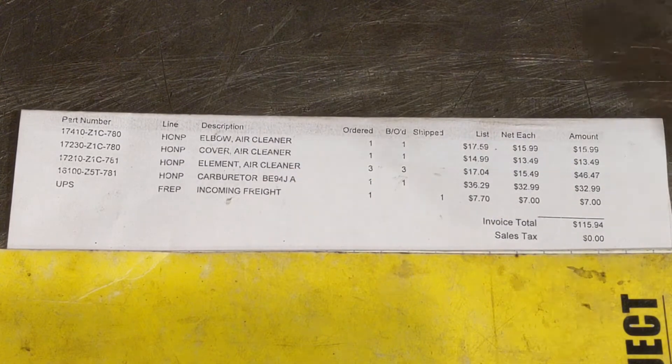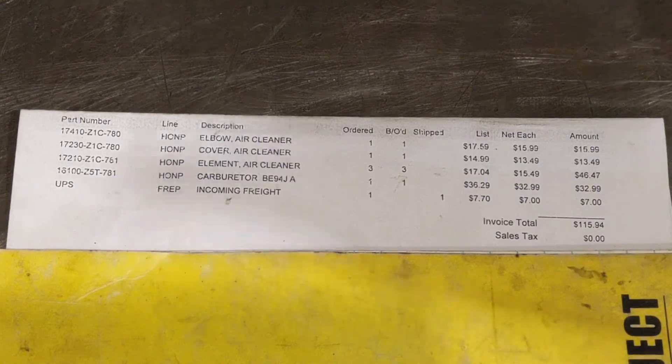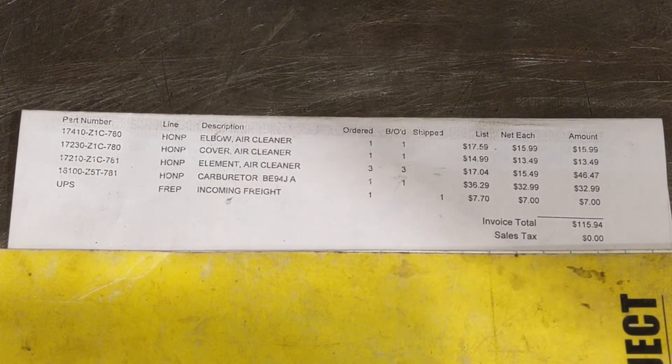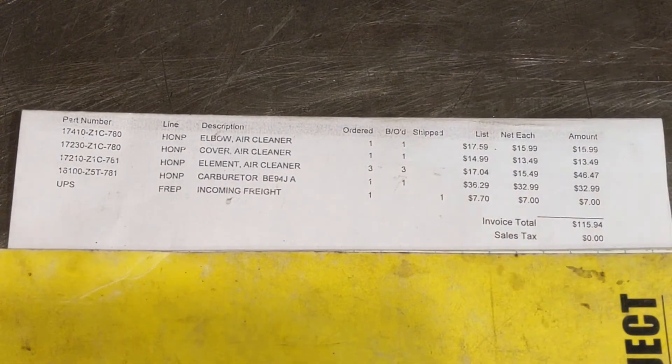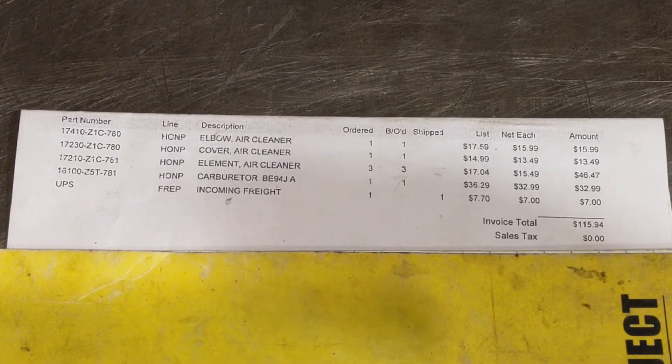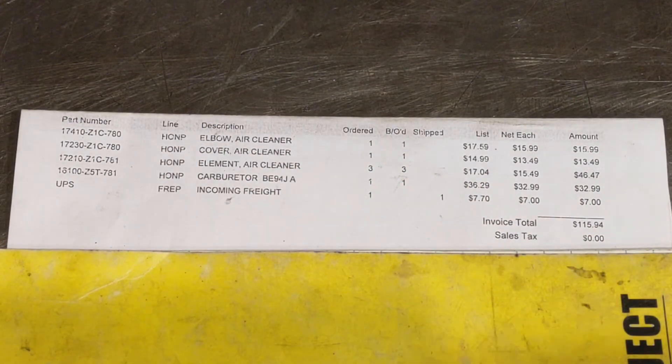The carburetor does change — the original carburetors are non-compensating, they will not adjust for intake restriction. When you put the pre-cleaner on there it induces a little bit of intake restriction, so you have to put that compensating carburetor on there. If you try and run the cyclone on the factory carburetor it'll run way too rich, blow smoke, run poorly, spit and sputter and that kind of thing.